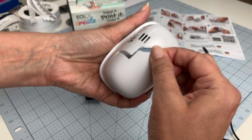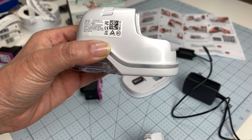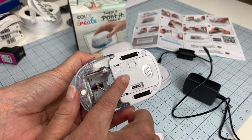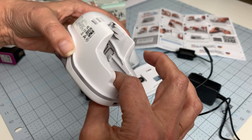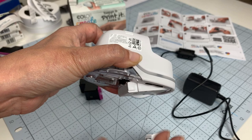To install the cartridge, first pull the cover off and snap the battery out — there's a little tab you push in to release it. Now here's the tricky part that people seem confused about: you have to drop the bottom door slightly first. There's a little arrow — put your thumb on that, your forefinger on top, push forward while pressing the top down, and the little door drops ever so slightly. Don't pry it with a screwdriver; it's not supposed to come off completely.